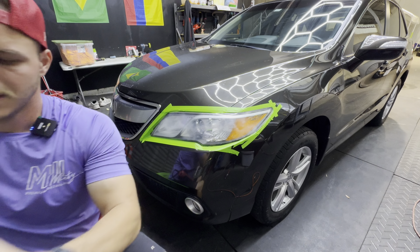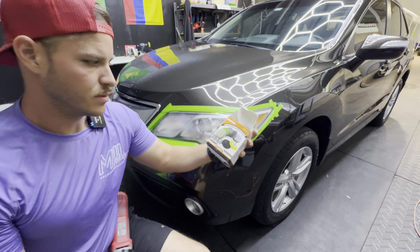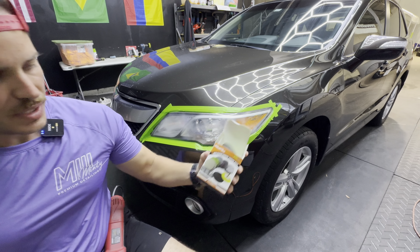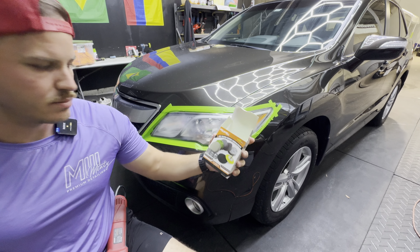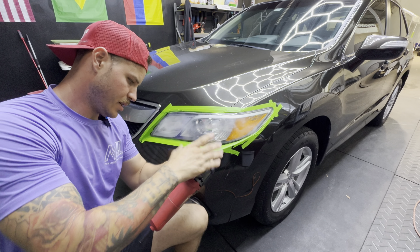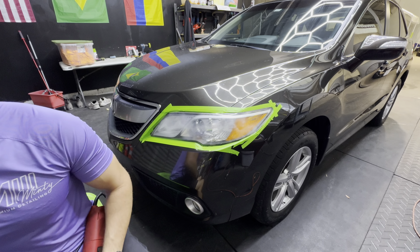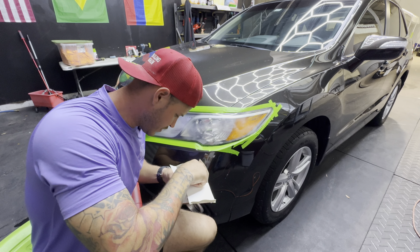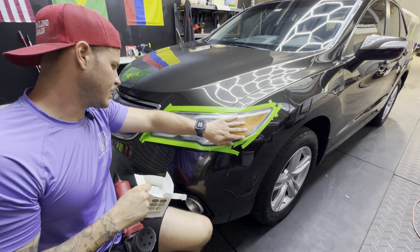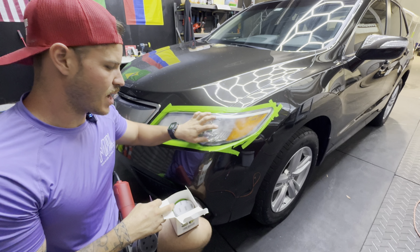First on my list is a little three-inch DA. I found a random kit on Amazon with a couple of different wet sanding discs — three-inch discs. Not great for paint, but decent for headlights. It came with a little backing plate, so go ahead and put the backing plate on your DA. I'm actually not going to start with 3000 grit like I normally do, because earlier the 3000 wasn't enough cut — there are a lot of scratches going across from whoever attempted this before.